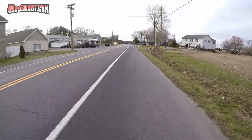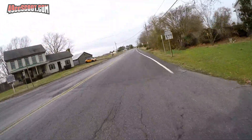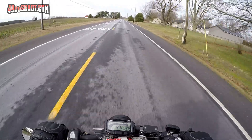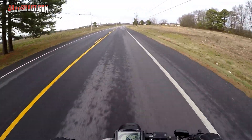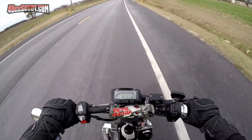For the second ride, I used the low beam headlight but turned the halo or DRL off. Power consumption was about 20 watts instead of about 26 with it on. That ride did pretty well also. With the new battery, when I ride around cruising at a higher speed, it's charging the battery. The only time I don't have charging is basically sitting at a light or going very slow in town. But it seems like as long as I can stay above about 7,500 RPM — roughly 30 to 35 miles per hour — it will charge the battery to some degree, and it charges just fine cruising at 40 to 50 miles per hour. I think I can probably even use my high beam as long as I'm staying around 40 miles per hour or above.